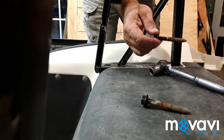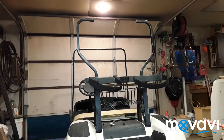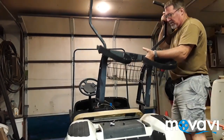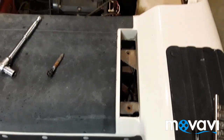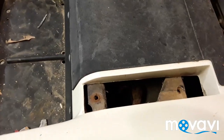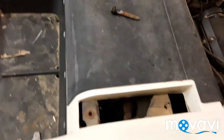The bolts were long and very dry with a little rust, but they weren't corroded too bad. Now I've got just the chain chassis frame on both sides that I need to clean up a bit. I'm going to clean those and give them a shot of some rust-proofing primer underneath, just to keep it alive a little longer.